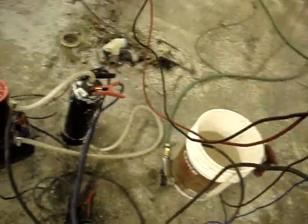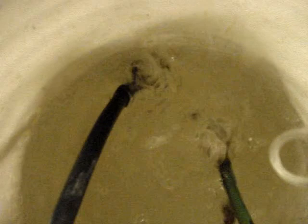Now we're going to go ahead and crank up the oxygen. And I don't know how much it's putting out because it takes too much time. But see, it's really cranking. I really cranked this up, so now we're running lean. But just from the looks of the output of this oxygen, that's a whole lot of gas. So 4 liters a minute of straight O2 won't change our O2 sensor 0.2 volts like everybody's doing. All you're doing is leaning out your system.